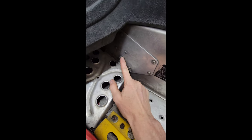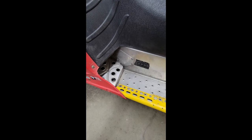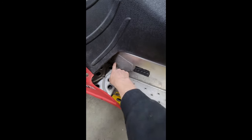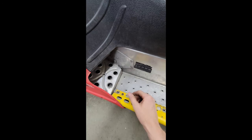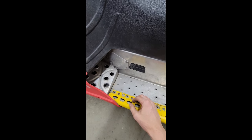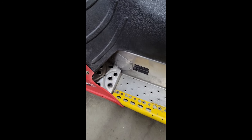The next step — you got the two bolts up in the front for the front arm of the skid. You'll just reach up underneath with your wrench and take the nuts loose, pull the nuts all the way off, and then we'll have to flip the sled on its side, pull these out the rest of the way, pull the skid up and out, and I'll show you how to do that here.